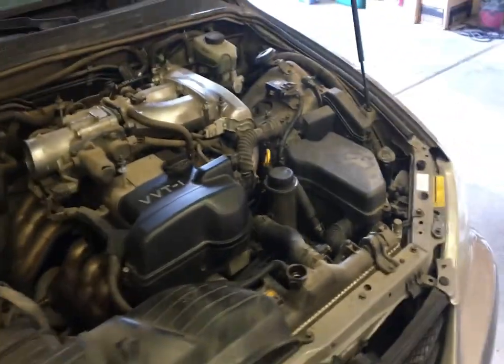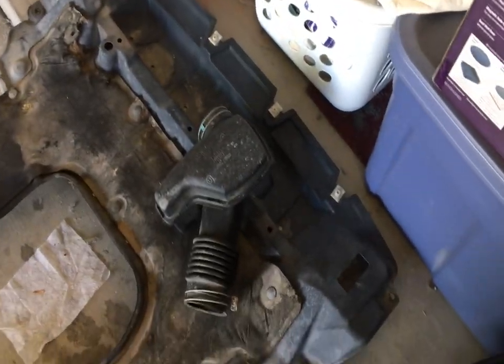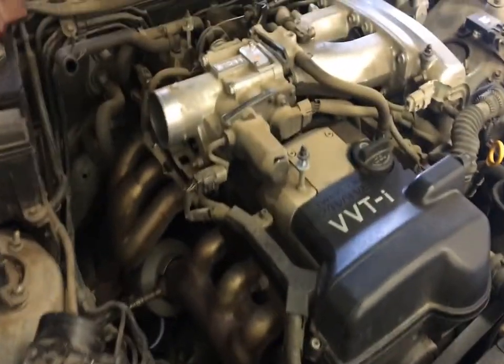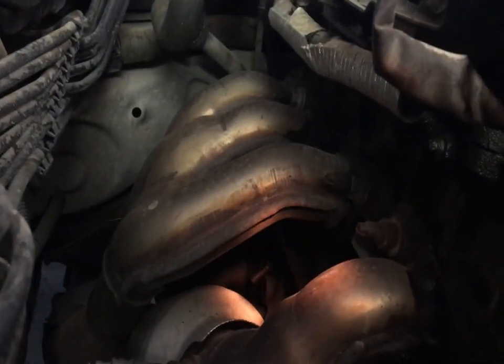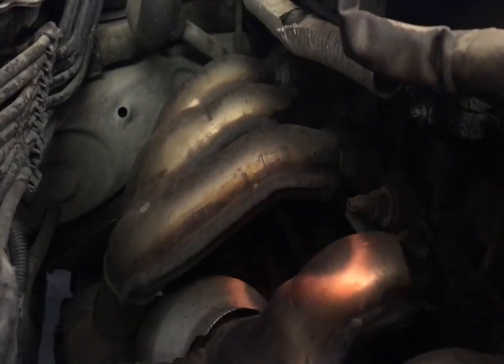The first thing I did was remove the splash guard from beneath, and I also removed just the air intake, that middle section there. It's pretty easy — just loosen these and then it tugs loose. It gives you a little bit more room to get to the engine core drain plug, which on this motor is located just beneath the exhaust manifold back here. It's a little bit tough to see but you can see it poking down there at about a 45-degree angle beneath the manifold.